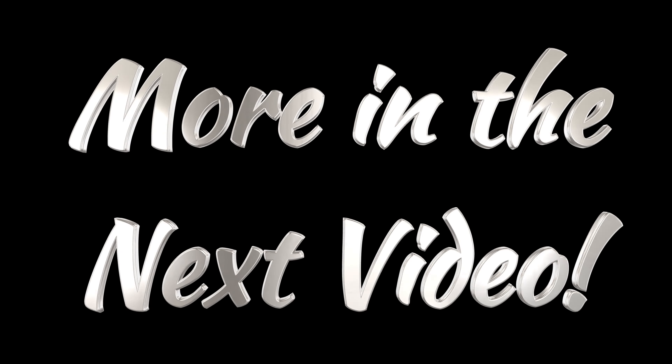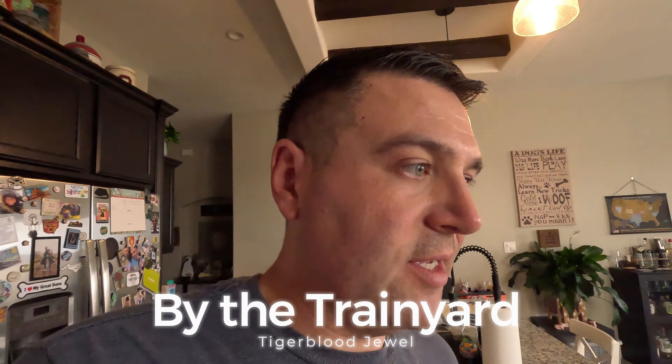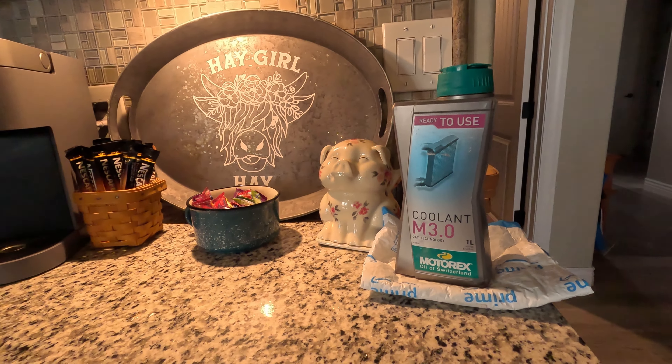Guess what it is — either way I'm glad it's not a major problem. Another thing: the coolant on the bike is green. KTM specifically in the manual says they want low-silicate coolant — they recommend the M3.0. But the M3.0 is pink, and on the bike it's green. So now I'm trying to figure out how to top it off. Maybe I can just add a little water, but they're ready-mixed and it's not like a car. So that's another project for another day.